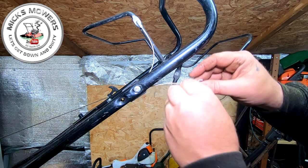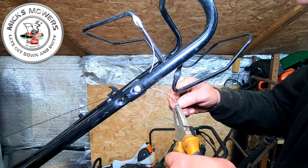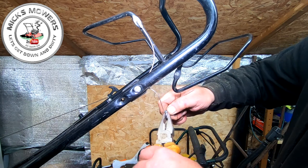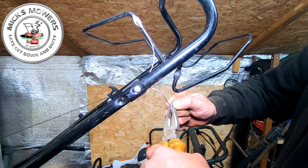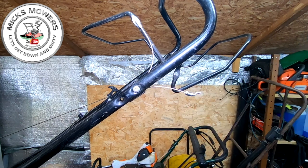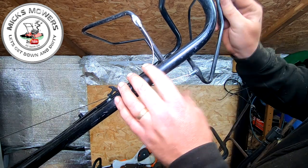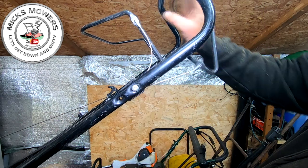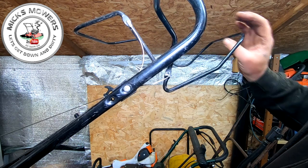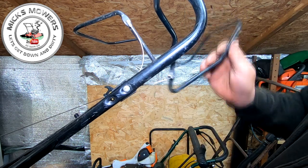Right, now, once it's done up, you can use a flathead driver. What I tend to use, because I want to make sure that's not ever going to come off, is a pair of pliers, and I literally force that on. There is a little tiny nut on the end of that, so you can put a socket on there, but I use a pair of pliers. Nice and tight, okay? So then you can hook up your drive into there, and look, as I said, fully engaged. Nothing worse than doing it and you can only engage it that far, okay? So there is a possibility it could come out. It could do. But nine times out of ten, it won't.